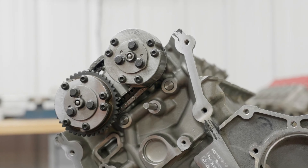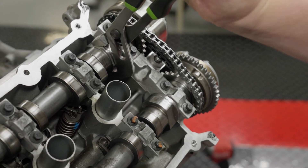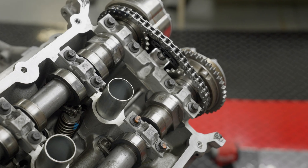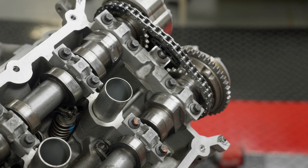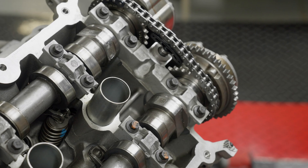In fact, if the cams do not move, use a wrench or a quality set of adjustable pliers on the flats of one of the camshafts and attempt to rotate. What you're looking for is a spot where the cams are at rest, where no valves are open, and no valve spring pressures are attempting to rotate the cams. You will find that the cams are either in a resting position already or they will jump to a resting position with little to no effort.